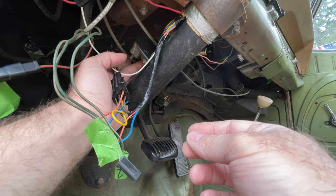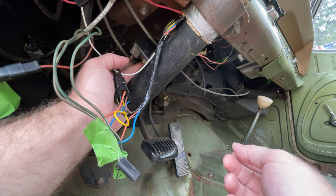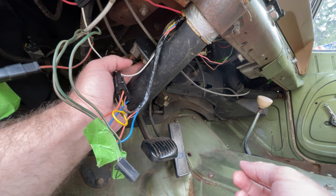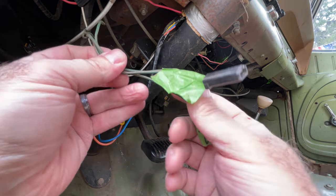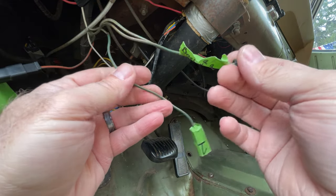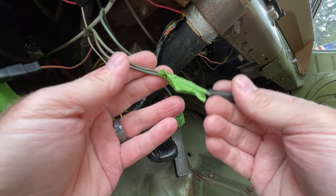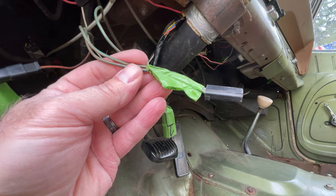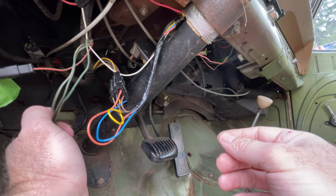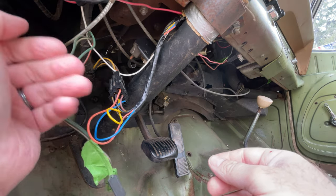I think I'll run a jumper wire from here up to one of the accessory powers on the ignition switch, and that'll be power to my backup lights. I've already confirmed this side of the circuit works - 12 volts sends power back, one of the lamps works, one of them doesn't, so I don't know if that's a bad bulb or bad wiring between the two. But at least I know the harness between here and the driver's side bulb works. I'll deal with the rest once it gets back there.